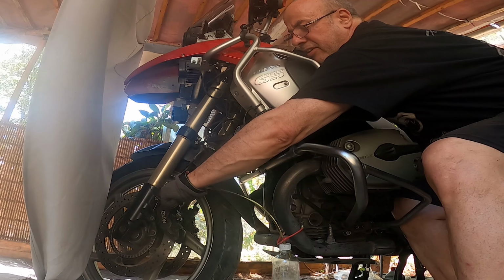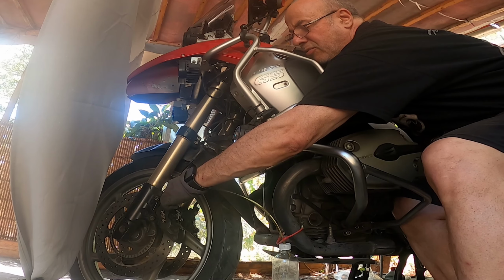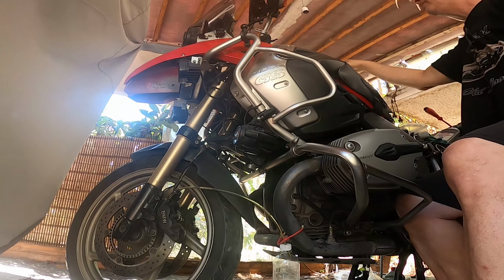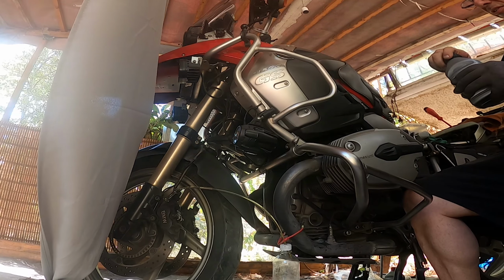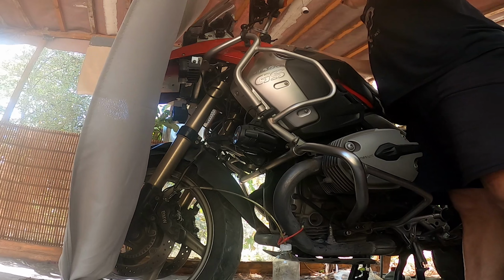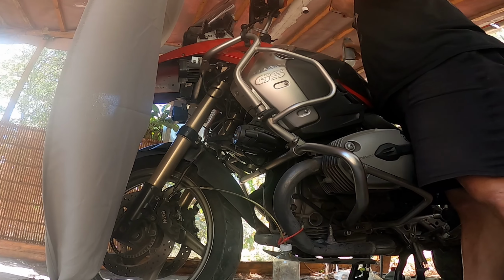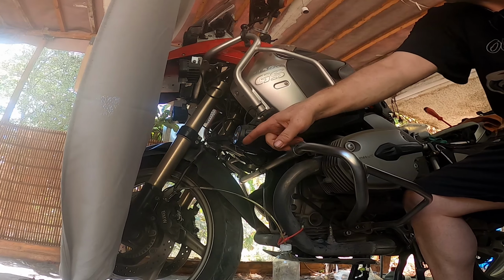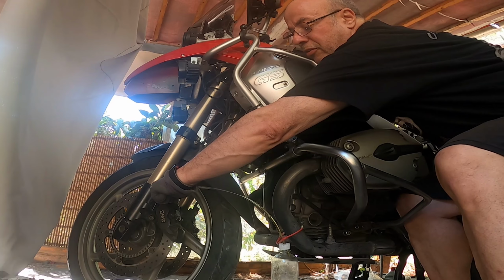The trick is don't open the nut all the way because it might get air inside, air bubbles. This is what I'm trying to do right now. That's why I concentrate. And I'm making this video in detail because people just pump and close that and close this, and you won't see the hard part. I'm filling up a little bit more, and the tricks are what make the difference. That's the one I told you: don't open the nut all the way. Just go easy on it because it might get air bubbles.